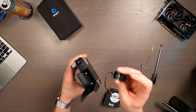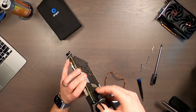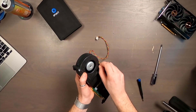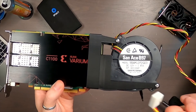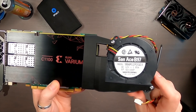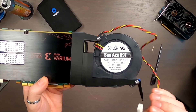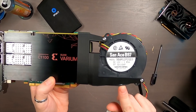The bracket is installed and I have a little adapter for the 8-pin to make it more accessible. Now let me put the fan on. The fan still needs to be powered — there's the power cable. It's rated for 1.85 amps, and according to the instructions I should use an externally powered fan hub or splitter because typical motherboard fan headers are only rated for one amp. I could use the motherboard header if I run the fan at 50% or less, but I'm not sure yet.